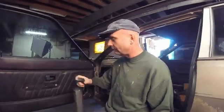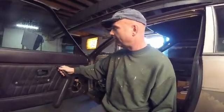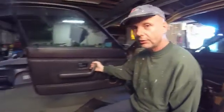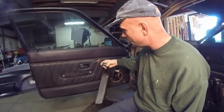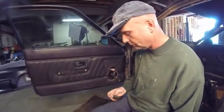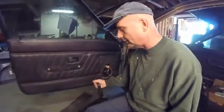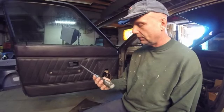And when you take the armrest off, you can see these little clips right here. They go in like this, then you bolt it to it. So whenever you take your Audi armrest off, you have to twist it to get these 2 blades, or 2 tabs, and pull it straight out. There's enough room, enough play, and you can do that. And this little trim piece right here is kind of movable. Also the screws for that are number 3, if I remember correctly. It's the big one.